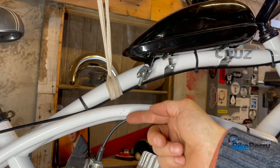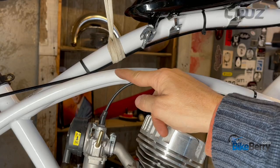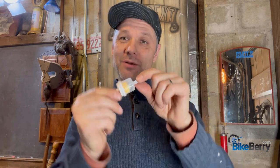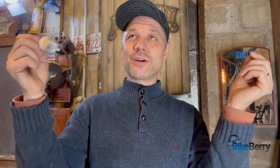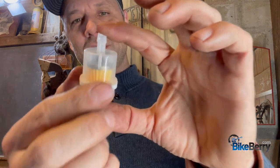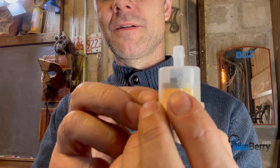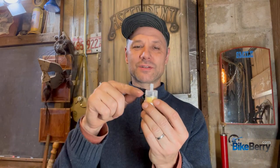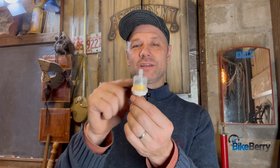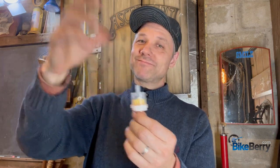You can see it goes just outside the tubing, running right to your carburetor — nice and straight. The filter direction was something I couldn't find clear information on when I first started. But if you look on the filter, there's an arrow. There's a little magnet inside to catch any metallic particles. The correct direction: clear side toward the tank, white side toward the engine. That's all you need to know.